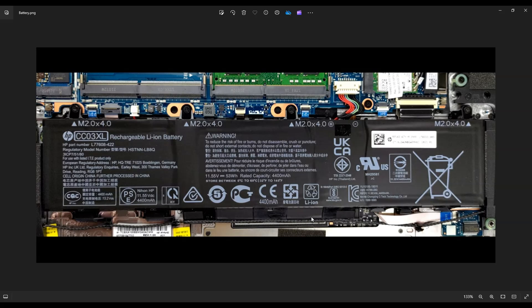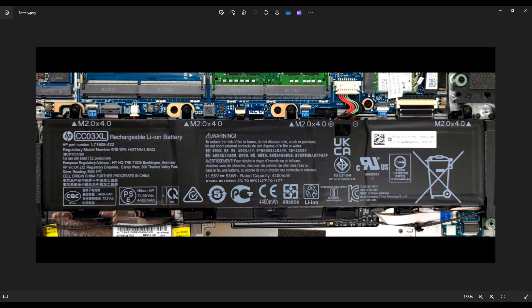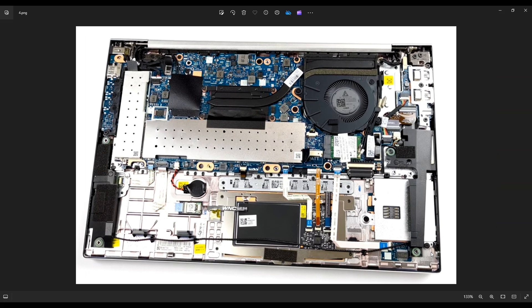You could damage your speakers. This is your battery plug right there. Some of you may have a black piece of tape over it — when the computer was first opened, you may have to bend that black tape back a little bit. After that tape is removed, you can unplug this. As with any wires in a computer, try not to pull on the wires. Put your fingernails on the grip of that plug, or use a pry tool, and jimmy that plug right out of that port. Now that the battery has been removed or at least unplugged, it's safer to proceed deeper into the computer.